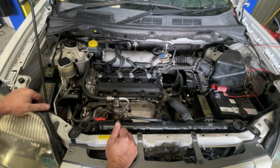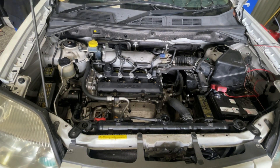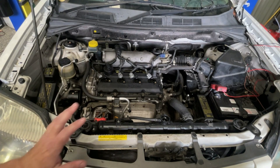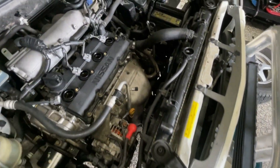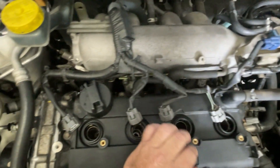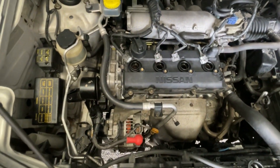With some oil in it, we're just going to crank it over. I just want to get some oil pressure running through it before we actually try and start it up. With that, I've now got my oil pressure light going off — let me show you inside. It's also a good time to check that you're not leaking any fuel. Everything looks good; if it's pumping a bit of fuel in, that's not going to cause an issue just yet.